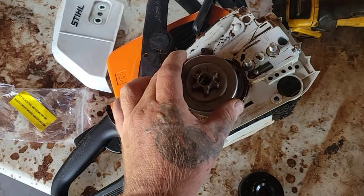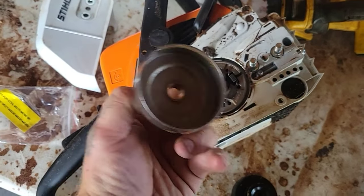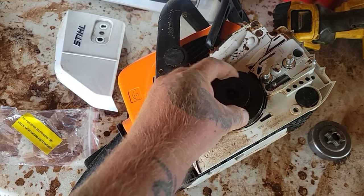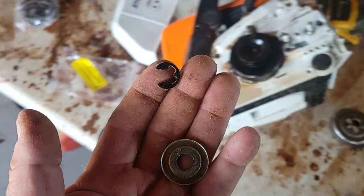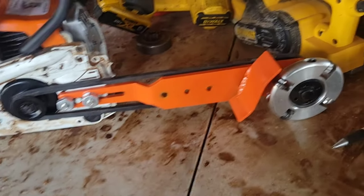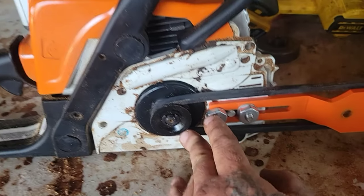So I'm going to get this on here. I don't know if you guys can hear me before, but I got that pin off there. You just pull this sprocket off. Super simple. You got the new sprocket. You put it on. Make sure it's on there good. And you put the pin back on. Where's the pin? You got this washer thing. And you got the pin here. See? There's the pin. Oops. Okay, so I got it on there. Super easy to do. Got the belt on. So now,